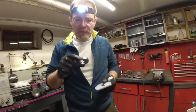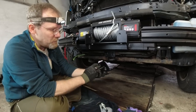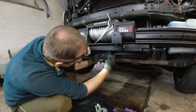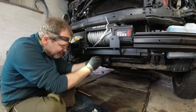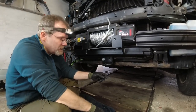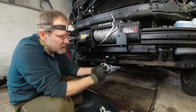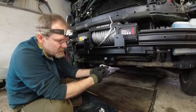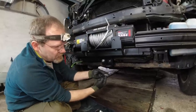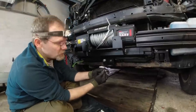This piece needs to be replaced. It needs to have only a hole and not a slot. And I got this bracket made with welded in nuts, so it's easy to mount, and it goes right in between here to get fastened down here. In order to still use your recovery point, you insert this piece, which is only a temporary one. I'm gonna change my design, so this piece only has a 17 millimeter hole. This way, the screw is not gonna slip forward. This is German screwed up engineering, and we're gonna make that German perfect engineering.